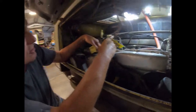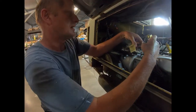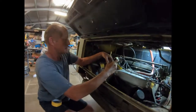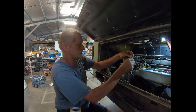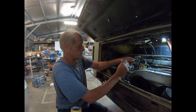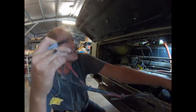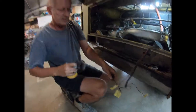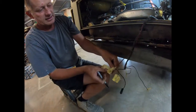Well, see, this is the thing, I'm pretty sure that standard from the factory, it didn't have that many wires, but all of these are going to the positive of the coil, so I'm just going to mark them as such. This one is piggybacked. So, you know, the true experts, I'm not one of those, I'm just going to put plus, because they all go to the plus C. And this one, same. You just want to have it so that the motor can drop down without you pulling on wires and ripping it all out. So I'm sure some of these things are extras.